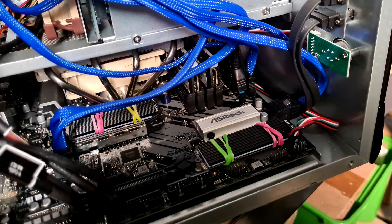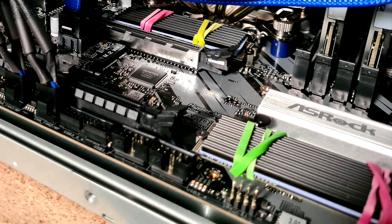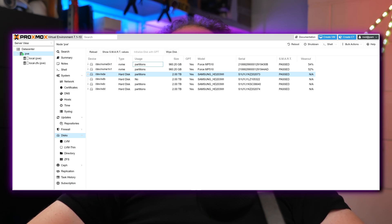Continuing with storage — for boot and VM storage, since the motherboard has 2x M.2 slots, I used two 1TB NVMe SSDs that I used before in my Chia farm. I used the drives to generate all the plots, so they did get a lot of wear, but I added them in a ZFS mirror as the boot drives, which gives me plenty of storage, even if I wanted to run a few VMs. These SSDs were used for Chia plotting, but as you can see here, they still have about 50% of their life remaining, so for the purpose of a boot drive and maybe a few VMs, they're going to last for years and years.